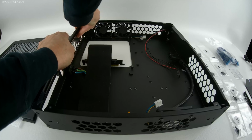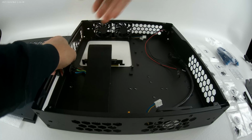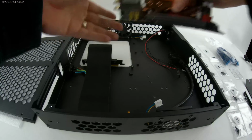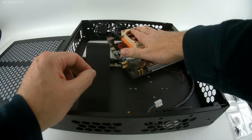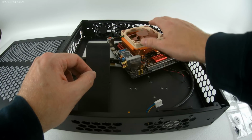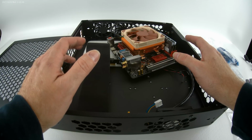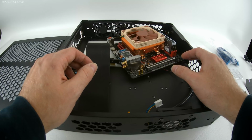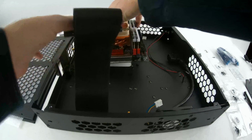Now the main board I'm using is actually the ASRock B350 ITX main board, and a 2700X R7 Ryzen AMD. I've got on this main board a Cryorig C7 copper with the Noctua A9 92mm fan. There's an adapter I purchased online to allow you to remove the C7 fan and install the Noctua, which is good for noise. I don't think it performs any better, to be honest. I'm not even sure the copper performs better than the aluminum. But I want to test this again once I get the rig finally set up. But the noise is definitely better with this fan.